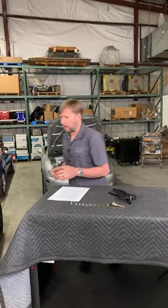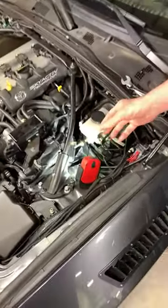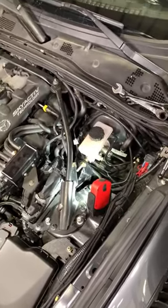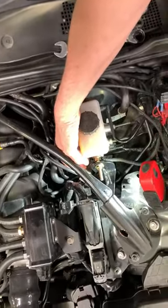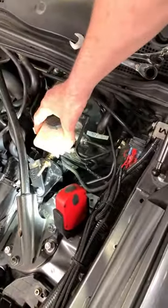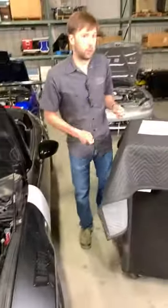Won't fit with the Fiat 124 because there's a coolant bottle right there. Won't fit with right-hand drive — a mirror image version might, but we haven't tried that and we don't have any right-hand drive cars here. One thing to note briefly: if you have our Hush muffler with the can control package — which gives you active control of the muffler and how loud it is via your windshield wiper stalk, look that up on our website — the solenoid needs to be extended out a little bit from the original bracket. Not a big deal. New kits come with that, but if you have an old kit, we'll have the extended version available on our website shortly.